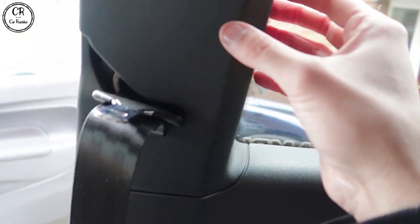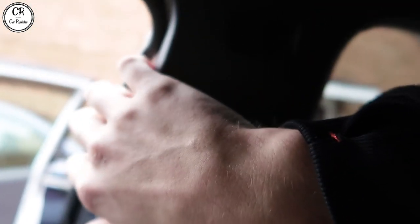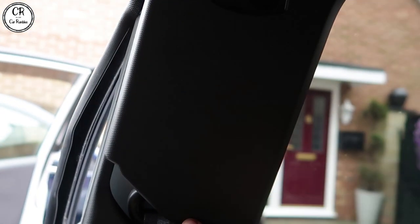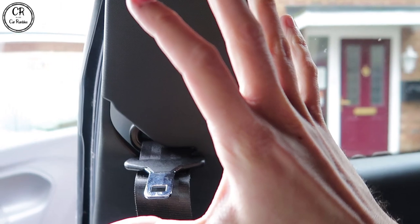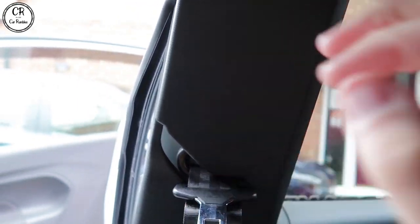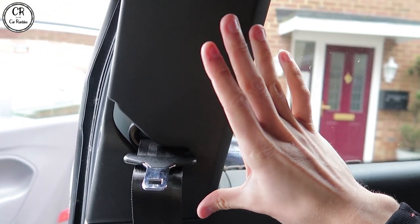Then we need to get behind this panel. I might pull this weather strip out just to see what's happening. So I've popped this panel off and behind there is a small Phillips screw. Looking down this weather strip that I've taken off, it doesn't actually look that hard to take off. We'll pop this off, but we've got to be super careful — there is still an airbag in here which has explosives, so make sure your battery is disconnected and do this all slowly.